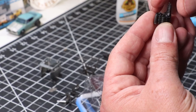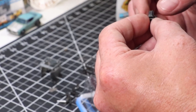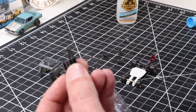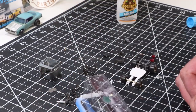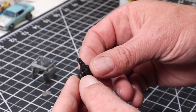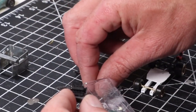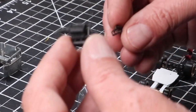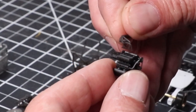But you can see I'm putting the transmission on there, which means I have to notch out the floor to get that motor to sit where I need it to sit. So I actually have to make a transmission tunnel and notch the firewall when I make that. So there's a lot of little pieces that go into making this that turns into quite a nightmare, and why it's taken me so long to find the time to do this. Because I got to have the patience too.